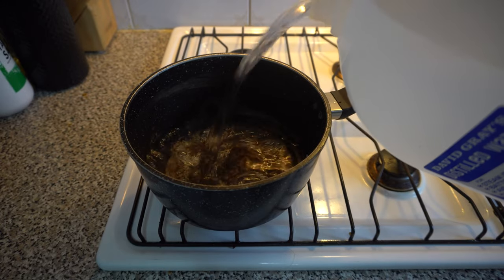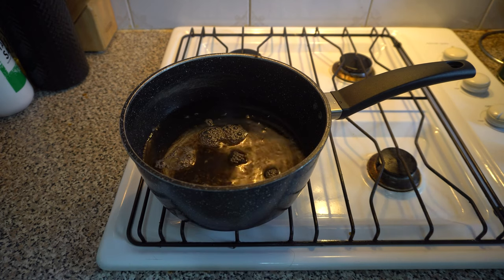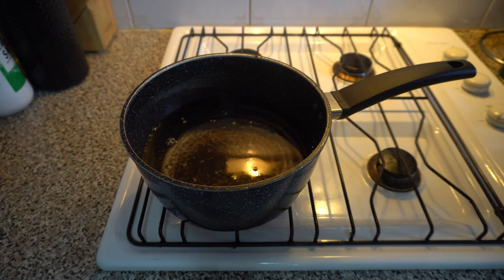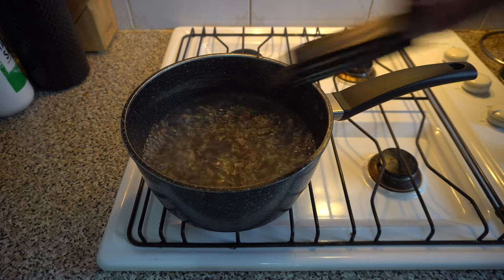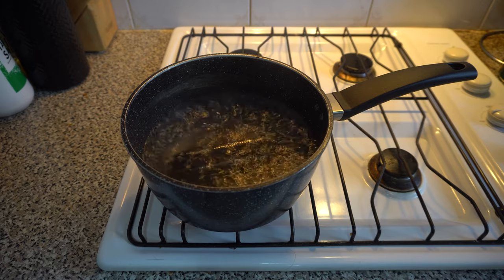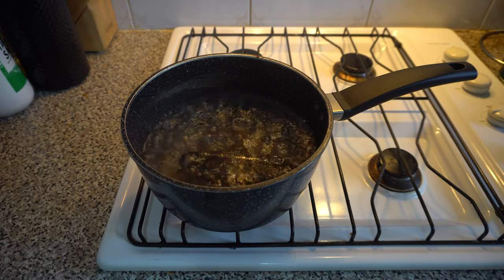I should point out that I do not take any responsibility for any melted cart connectors if you follow along with what I'm doing here, but I can say from experience that mine didn't melt, at least, and supposedly the metal of the pins is a type that won't rust. So once the water is at a nice rolling boil, that's another phrase I thought I would never utter on a retro gaming channel, plop that cartridge in for about 5 minutes.